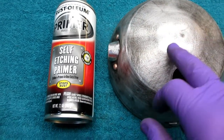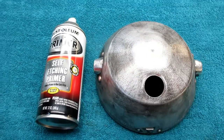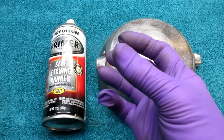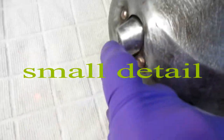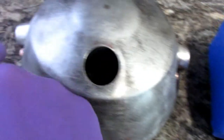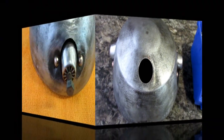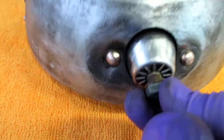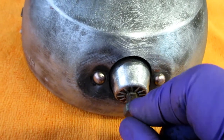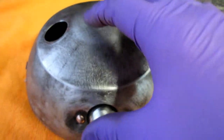It's still drizzling out there, but we're going to wait for a little window and get in between the raindrops for one coat of self-etching primer. Because we already have a really good tooth, this should really bond the paint to the metal. One more detail: there are threads in here and here — I don't want to get paint on them. So I'll go through my bolts, get an old bolt to seal up one side, and leave the other one sticking out so I can grab it with vice grips as a handle while painting. This is perfect — I can grab this with vice grips, hold it while I'm painting it, and then hang it up by the vice grips to dry. The heat is on in the house at about 38 degrees outside, so it should dry up very quickly.